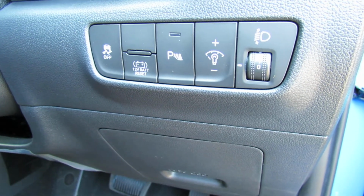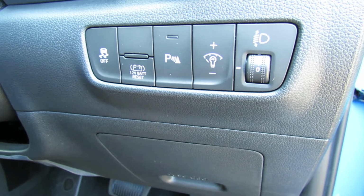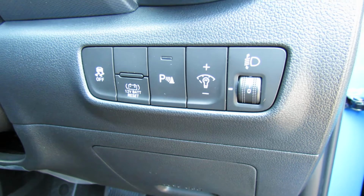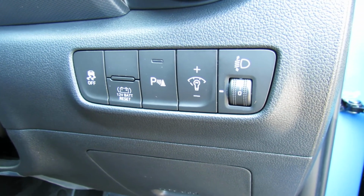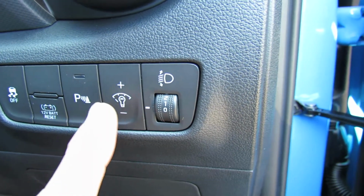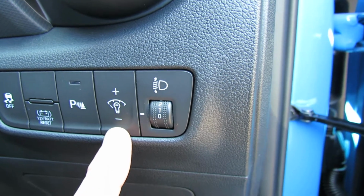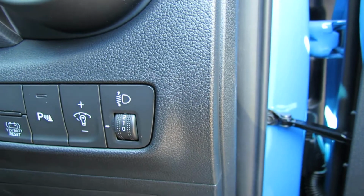What you can actually do is leave the car running. You have to put the fan on, so there's something in the car that's actually whirring away, and then it will recharge the battery for you, and when it's charged the engine just cuts out in normal stop start mode, and that's when you know it's done. Nice and simple. Or of course you can drive along and it'll recharge that way. There's your parking sensors off. That's what you brighten or dampen down the bulb display. And then that's to adjust the wing mirror, the headlight adjusters.